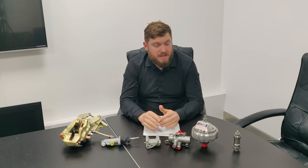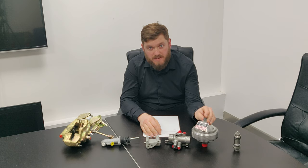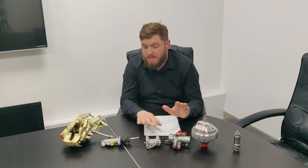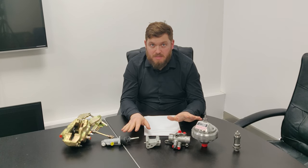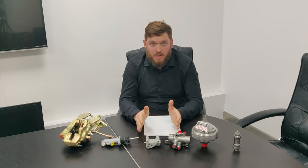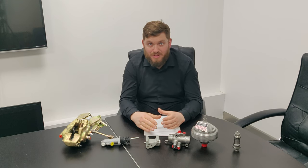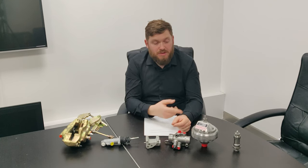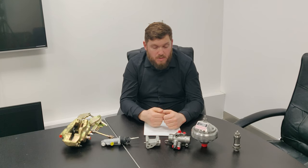The Silver Spirit system is very similar, except you get the green Citroen style spheres, disposable throwaway ones, and a different looking valve body, and obviously completely different fluid. In 1980, when they go over to the mineral system, there's a big thing on the reservoir saying what type of fluid you should use, and you always have to make sure that you're using the right fluid, because if you do use the wrong fluid, all of these components would need to be changed and resealed, and it's a lot of work, along with the pipe work.